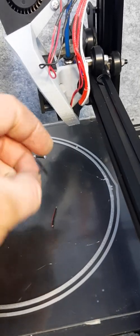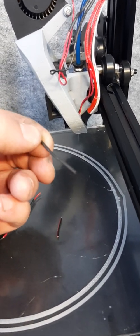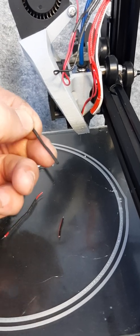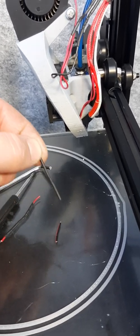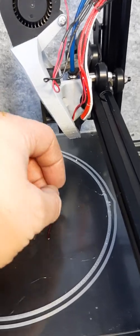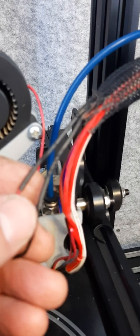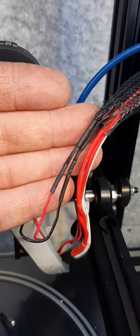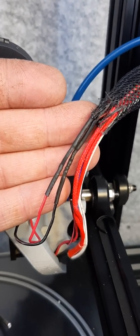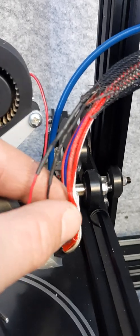I quickly found out by giving a tug on the wire that my heat shrink solder connector had a broken wire inside — I was able to pull the wire out, which shouldn't happen. That means I hadn't done it the same as the other cooling fan connection where I had properly soldered and heat-shrunk them. One of the wires inside broke, probably because the solder connection was right down here where it connects.